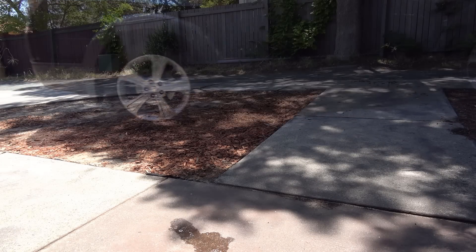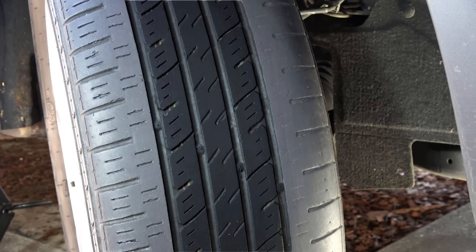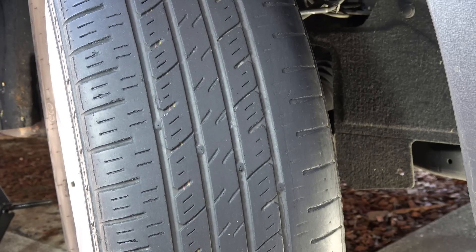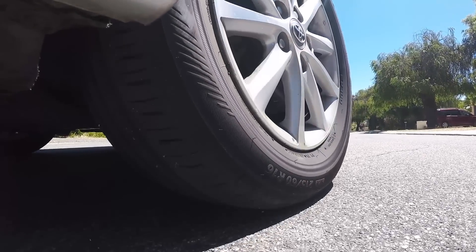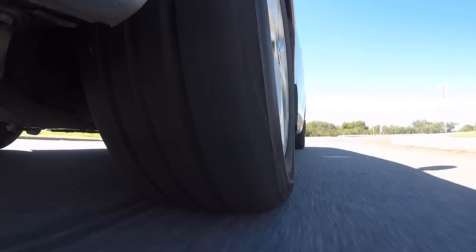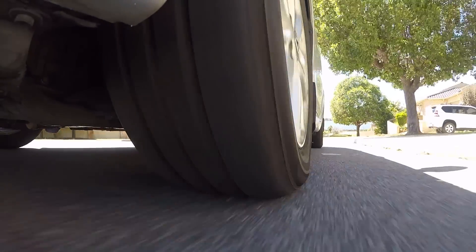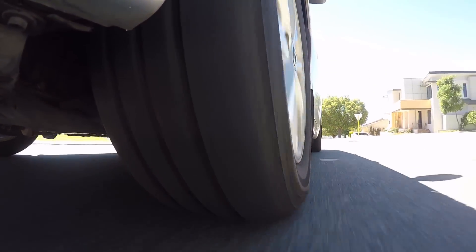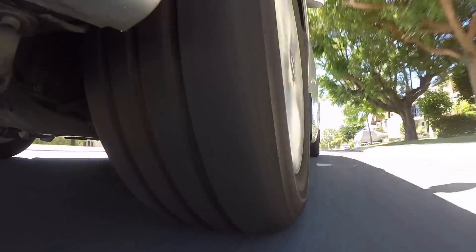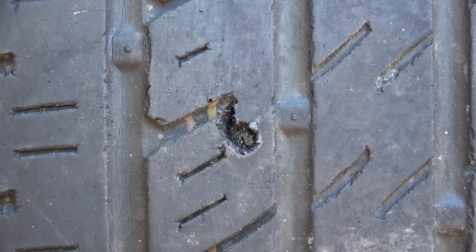Having said that, this tire plugging can only be done if the leak is in the tire crown, which is the tread area. If the leak is in the tire shoulder or in the sidewall, then you can't plug the tire — it is not safe. These areas are designed to bear the weight of the vehicle, especially when you are cornering. There's a lot of flex on these areas which puts a lot of stress on the plug. Even if you take the car to a tire shop, most likely they will advise you to replace the tire.